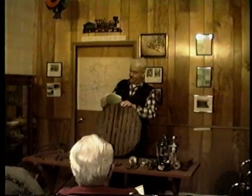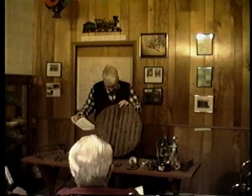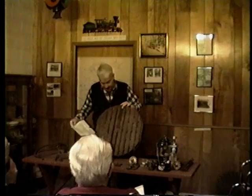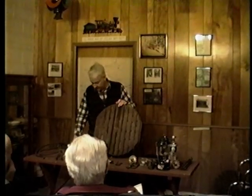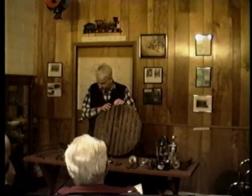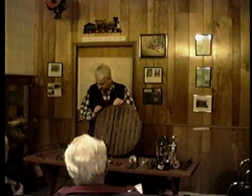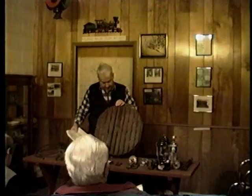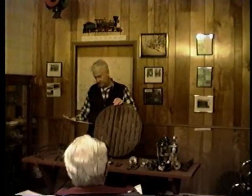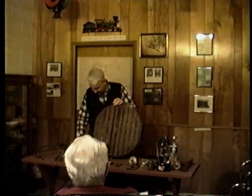54 drill size. And as you can see, that was a fun job. There's so many of them. This one probably has 5,000 of them or something. But that worked better with the kerosene. Evidently, the kerosene needed the smaller hole to burn properly, so that's how they changed it. And they probably went through a lot of guys at the Stanley factory drilling holes. Did a terrible job. The vaporizer had to be longer.